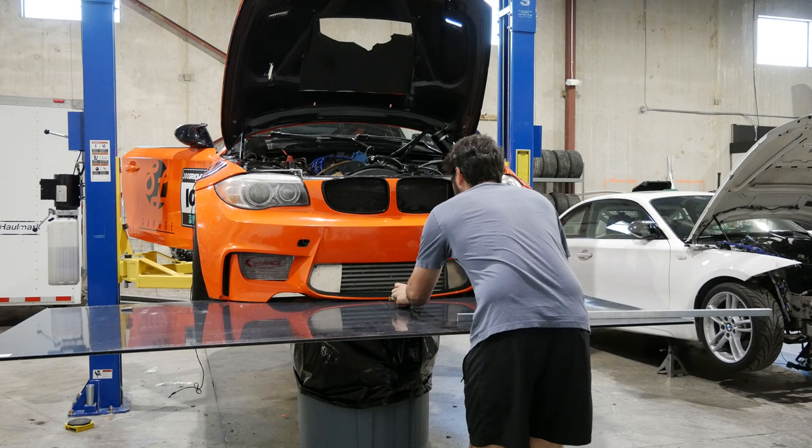All right, so after a dead battery, this is what I'm gonna be doing. Ooh, too much. All right, so I'm gonna have one of these rods. It's gonna go through the bumper. It is what it is, nothing I can change. Then I have this beefy rod going down to a square tube going across, so that will help with side-to-side stiffness. And then in the back, I have those drop downs, and then I just welded some pipe over a flat piece of bar stock that's then bolted to the splitter, so that way I can just pull that bolt out through the center and then the whole back will drop down.